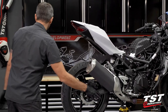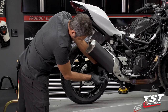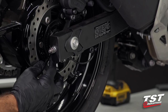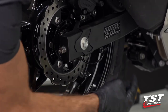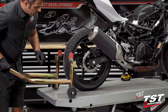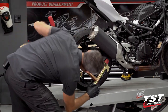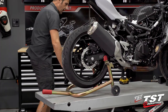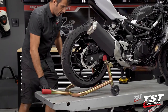First step: if you have any spools on the bike currently, please take them off. I'd like to point your attention to this quadrant of the bike — right here is a cable that is hooked up to your speed sensor. Next we'll be lifting this bike on a padded stand, and we have to make sure not to damage this area, so we have to go forward of that. We will need a padded stand so we can avoid using any of the lifting geometry on the swing arm and still manage to get the wheel up. Now I'll drop the cotter pin out of the nut that fastens the axle on — once that is off, we'll be able to take the axle off and the wheel will come out.